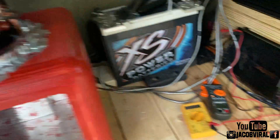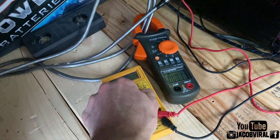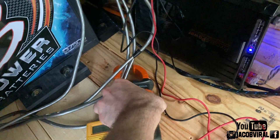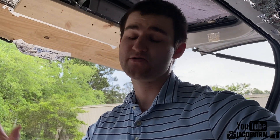That's all I got. I hope you guys learned something — this is how you clamp power watts, true watts out of your system. It's a 2000 watt amp and that's what I got out of it. I didn't turn it all the way up; the subwoofer has some things it doesn't like. I need to change my subsonic and my gains — I could have been clipping there, but I doubt it because the power would have been a lot higher. If you have questions, comment. See y'all in the next video.